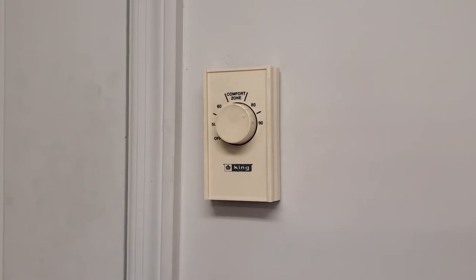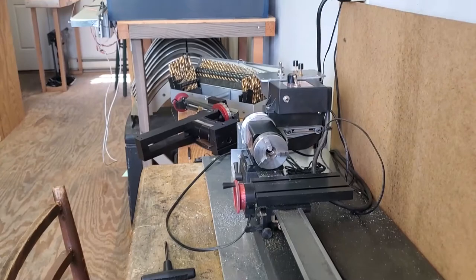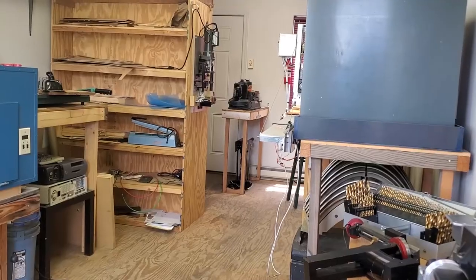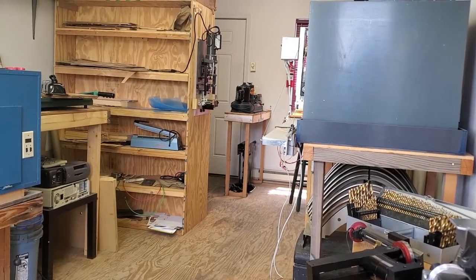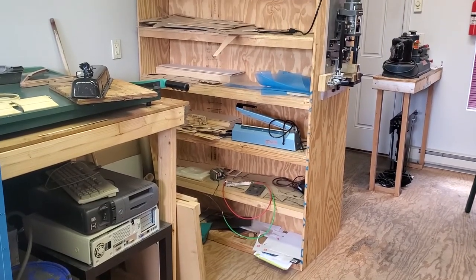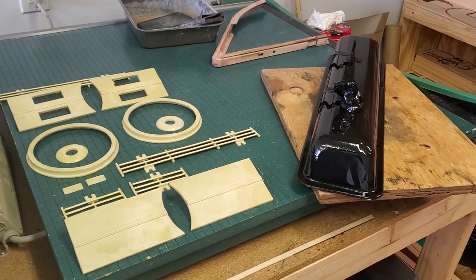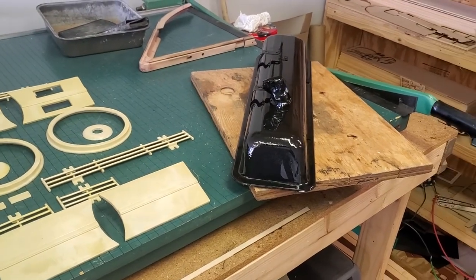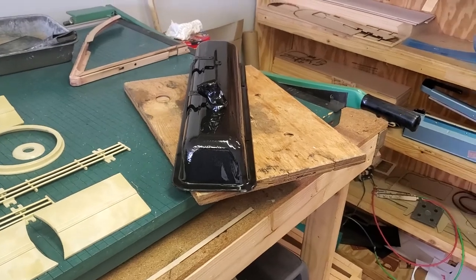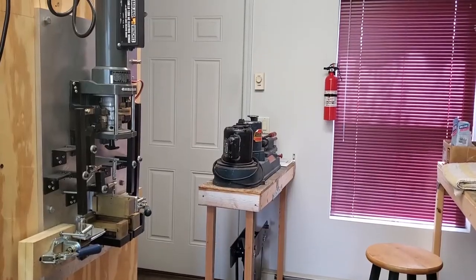So we've taken this up to what we call the machine shop. And I've actually got the electric heat running to bring it up to 85 degrees. It's not on the VHT can. But if you don't heat it up like this, you won't get the unequal shrinking real well, where the surface puckers up and you get a beautiful wrinkled finish. You've got to have high heat. Don't care what the can says. I haven't been able to make this successfully work without the temperature up like this.